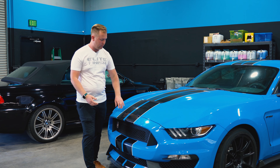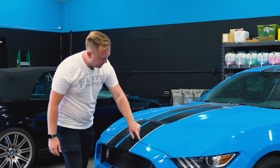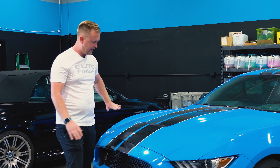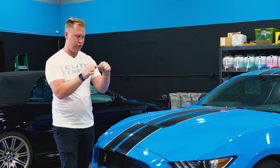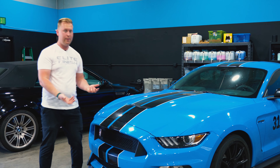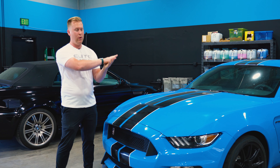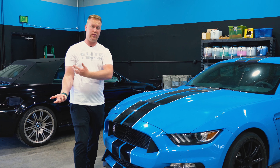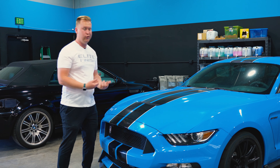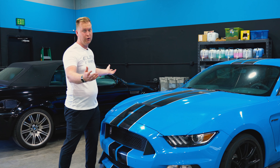That method has its place, and the benefit is that when you do film over the stripe, you'll get a bubble line on the edge because the film can't conform completely to that change in elevation in such a short space. The other option is doing film underneath the stripe and then doing the stripe on top, where you'll have an edge of the vinyl that you can catch a towel on — that's the downside. The upside is you're not married to that stripe. If you want to remove it at any point, you can, and your film is still there.